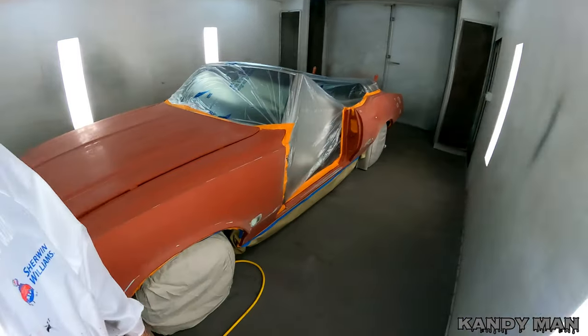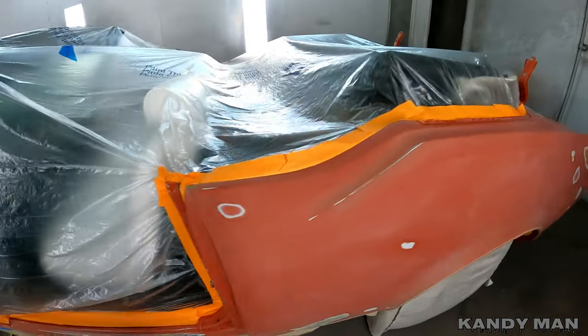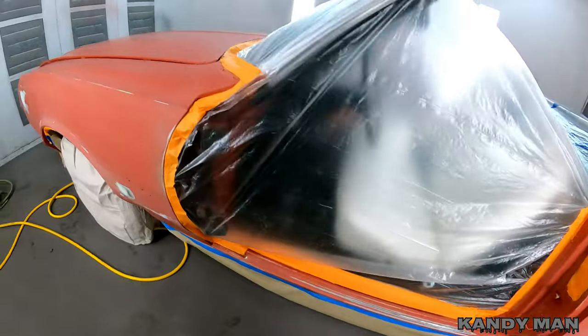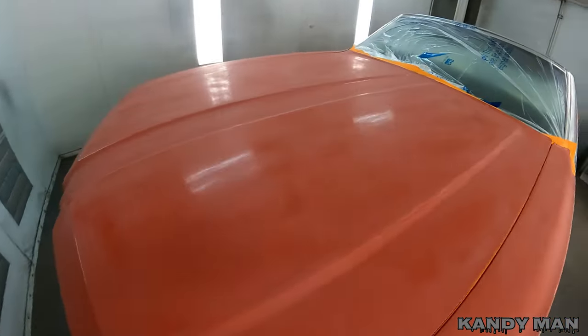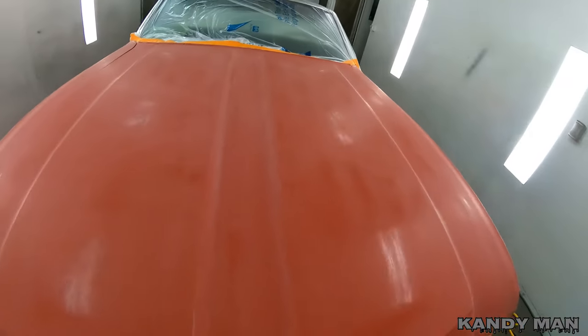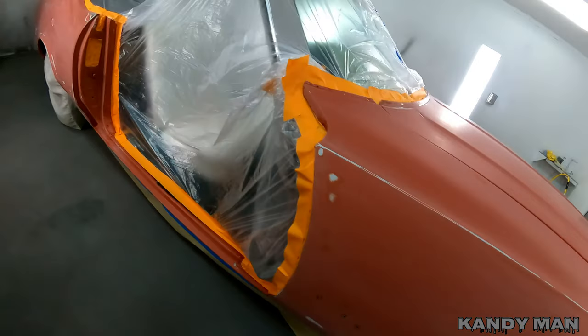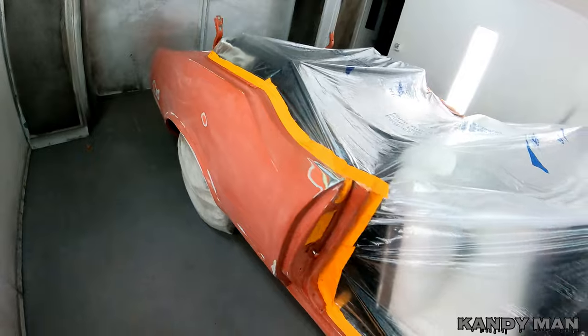So as we come to this stage here, we're gonna go ahead and start priming it. I went ahead and did it with the microfiber towels. That way it's kind of tacking it and cleaning it at the same time. And a lot of you guys know about the microfiber towel deal. That came out, somebody figured it out, and now everybody's doing it because it really works good. It cleans it well and gets all that sanding dust out of the sand scratches.